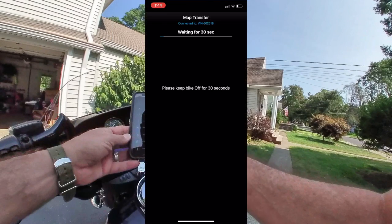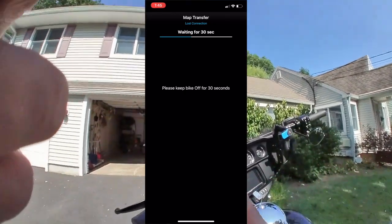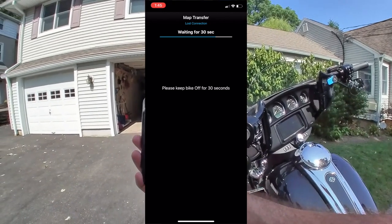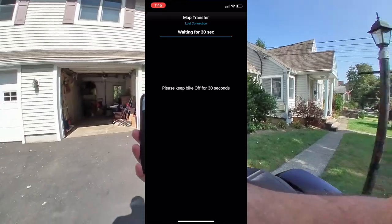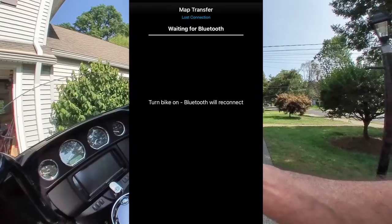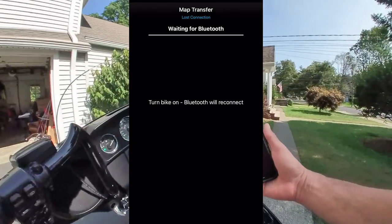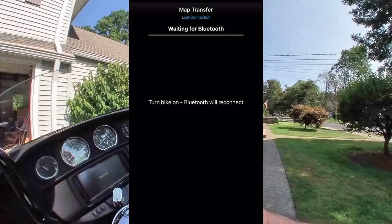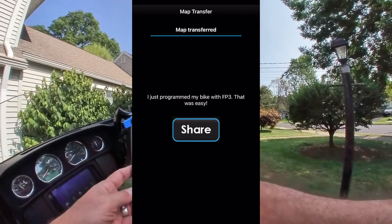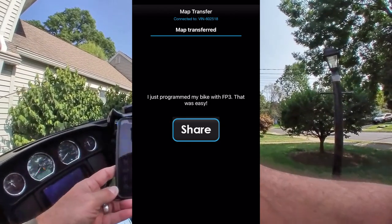And now, pretty much, it's telling you to turn the bike off. So, literally, switch to off and wait for 30 seconds. This actually has a countdown on the top over here. Once you meet that 30 seconds, it's going to tell you to turn the switch back on. And it's pretty much going to flash — save in the memory on the ECU the new map that you just chose. There you go, now it's asking you to turn the bike switch back on. Turn the switch back on. The bike's ECU is going to be flashed with the new map that we just downloaded. There you go. Now you see the map is actually — the app is showing the map was transferred, and it asks you to share on social media, whatever. You're done. And now the bike is going to run beautifully.